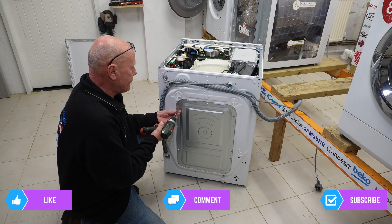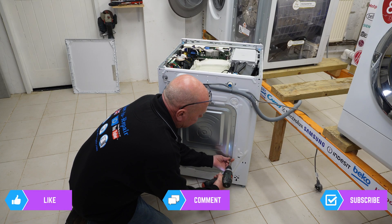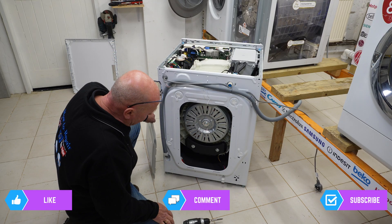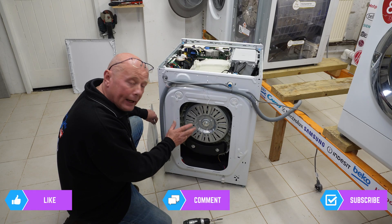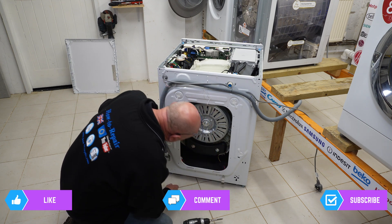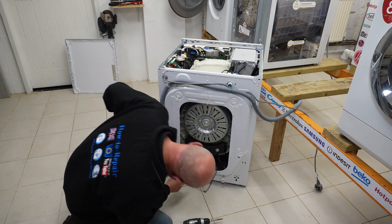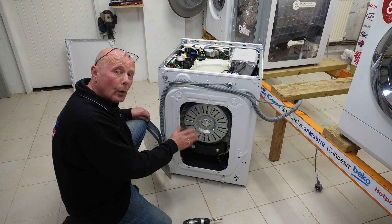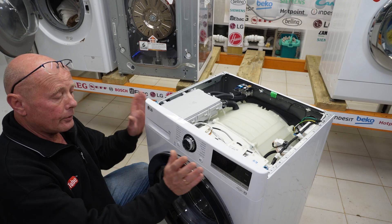The first thing I'm going to do is take the back panel off — no difference in the construction design here; it's exactly the same as machines that are nearly 20 years old. Hold it in the middle and just pull it away. Standard LG motor system — maybe some variations on part numbers; I've done a video previously on the motor and the hall sensor, so if you want to see that, jump into the playlist. Looking down the machine, there's the standard shock system — there are three shocks on this machine. There's no access from the bottom and no anti-flood device built in either, so if you get a leak the water will all go to one place.